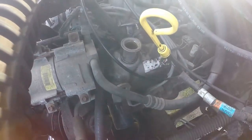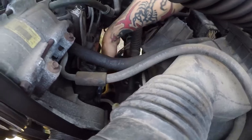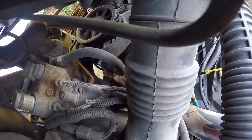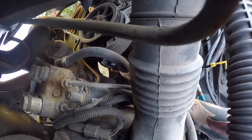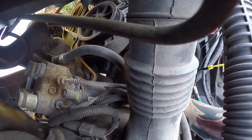From the top here's where our oil fill is. Now we go down here — there's our oil filter right there, that's what we're going to be going for. These bad boys come in handy. I think I loosened it enough with my little grips. See if I can do it by hand. The key is to try to tilt it upwards since this is at an angle mount, to try and minimize as much oil from dropping down below as I can.